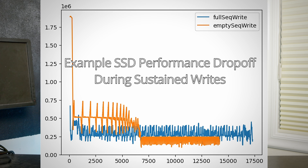My Crystal Disk Mark testing was done from a RAM disk so SSDs weren't a limiting factor. When I introduced SSDs into the mix, I found that even SSDs rated for faster than 40 gigabits of performance are relatively hard to maximize. My workstation doesn't have SSDs that can consistently hit those speeds either, since SSDs only hit maximum performance in certain workloads and for limited periods — especially consumer grade drives that slow down significantly after filling their SLC cache. So while sequential speeds on 40 gigabit connections are impressive, with random IO you often won't max out even a 10 gigabit or sometimes even a 1 gigabit connection.